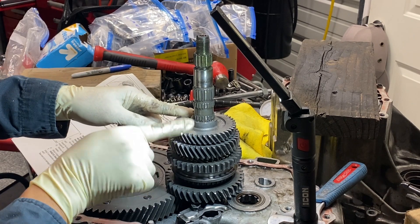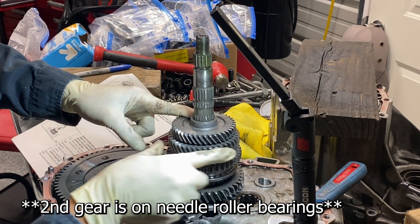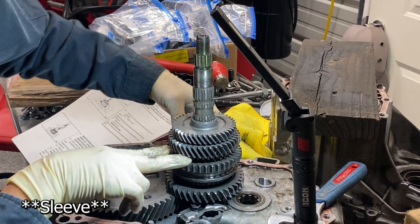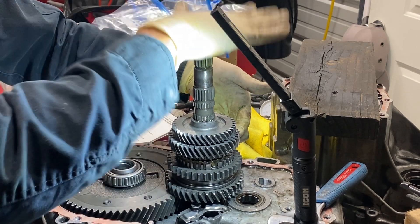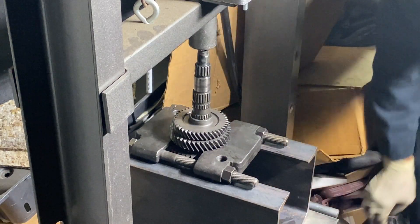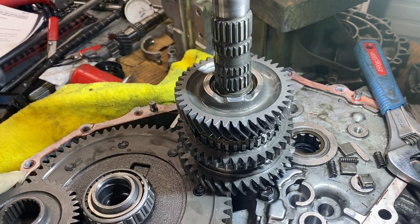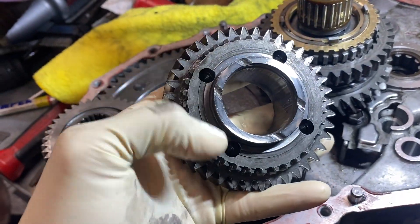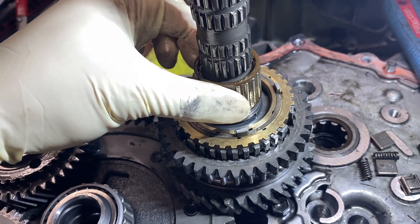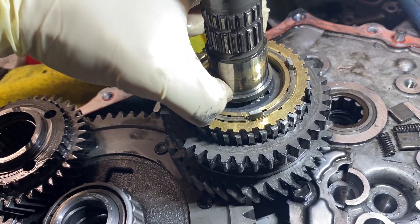Now we need to remove the third driven gear - you can see it's pressed on because it's splined onto the output shaft. And we've got to remove second gear as well. Second gear is on a roller bearing so it's not attached to the shaft, which means we can grab underneath it and push it up. Let's push this synchro ring down, grab from underneath here, and then start pushing on the shaft down in this section to press those guys off. This is the third driven gear. This is second gear. Under second gear you have four holes that have to fit on four protrusions in this little silver guy. Now we're going to take off this needle roller bearing for second. There's a little spacer right in here - you can pull the spacer out.